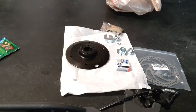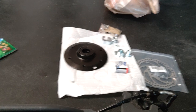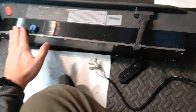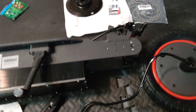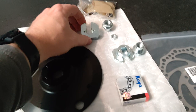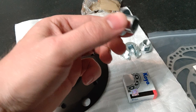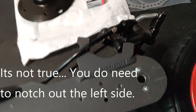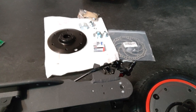I'm getting close — just need to mount this motorized wheel. The casing is all done, dashboards wired up, all the wiring is good, just need to get this motor installed and mounted. I've got my kit here from M365 Custom Parts — it took about 12 days to get here from Croatia. It's beautifully machined. I have a completely stock M365 Pro frame, and I've heard you can drill out the side rather than cut a notch in it, so we'll try that.